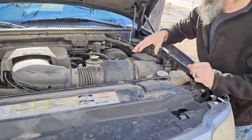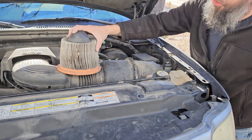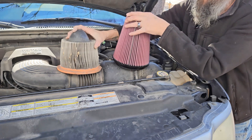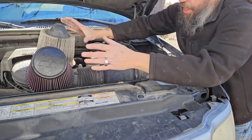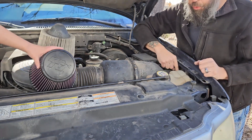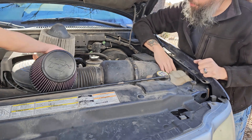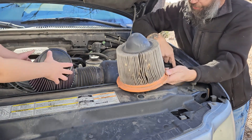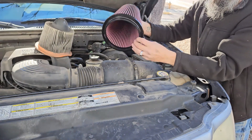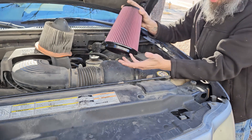This is the old filter - you can see that's a pretty decent size. This is the new filter, and although it's quite a bit bigger, that alone isn't going to make the difference we're looking for, because the choke point for getting air into the engine is where you get your power. The choke point is right down here where this little tiny tube plugs into the fender - that's where it has to get all its air. The cold air intake is going to get rid of that choke point, and instead of air coming through this tiny hole, it's going to come unobstructed into this larger filter. More air equals more fuel - that's the concept of the whole thing.